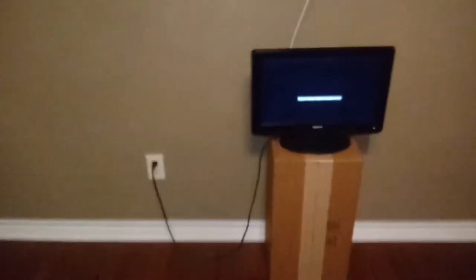As you can see in the setup I have right here, the electrical cord on the television is going away from the antenna. And I have the cord on the antenna going in the opposite direction, with the cable on the indoor TV antenna going as far away from the digital television as I can so that it doesn't cause any interference with our reception. I also have the antenna up as high as possible. As a general rule of thumb, you always want to have your antenna up as high as possible.